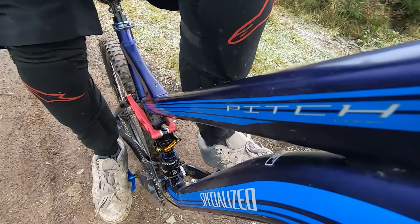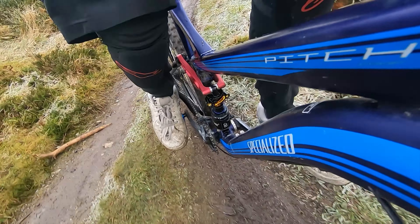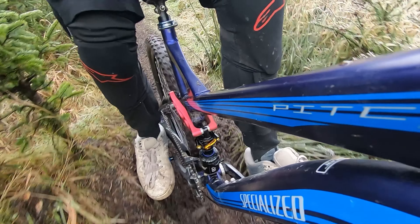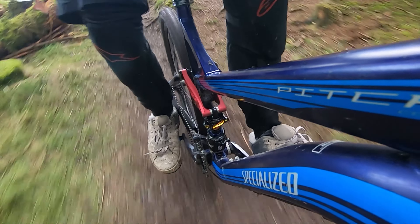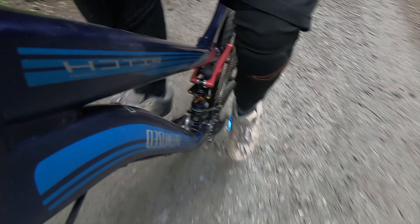Installing it is just the reverse of removing the old shock. You might just want a second set of hands to hold up the wheel and take the weight off so you can position it just right, but I was able to jimmy it into place myself no problem. When I arrived at the trail, I set the pressure in the rear shock to about 190 PSI, which gave me about that 30% sag they recommend at the rear shock — I'll leave a link in the description to show how to properly achieve that sag, as Cane Creek do a great video on it. My first impression when cycling uphill was just phenomenally good. The lockout was working great. I could see in the video there was a little bit of bobbing, but when I was cycling uphill I didn't feel it at all. It felt nice and solid, and I really felt like I was transferring power to the back wheel.